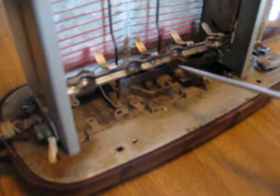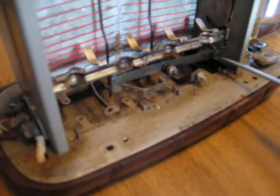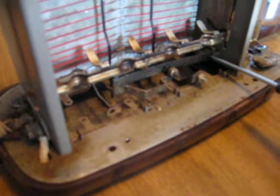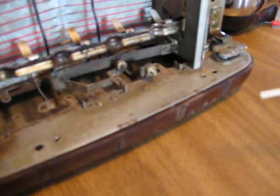And as it heats up it bends and curves this way. Now, if you can hear the ticking — and I suppose you can, listen — as I push that back it slows down. As it bends over, it pulls on a little stud that you really can't hardly see.